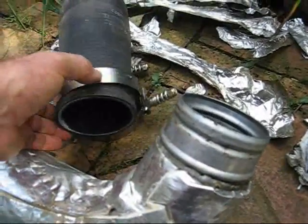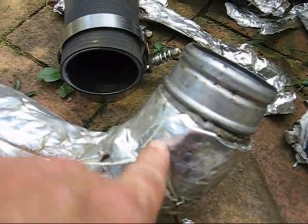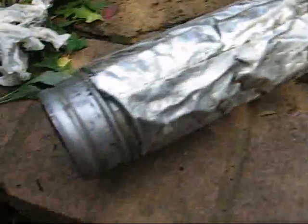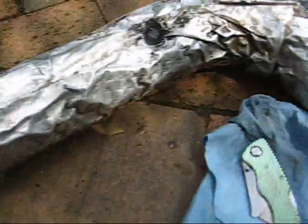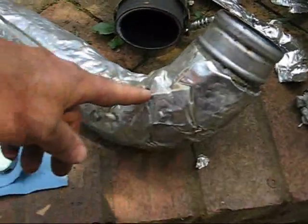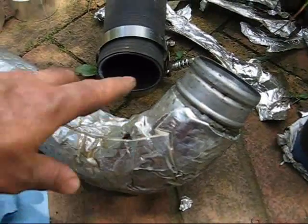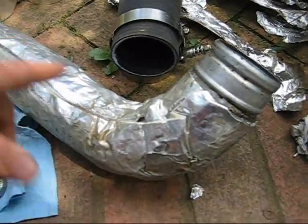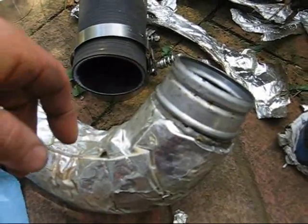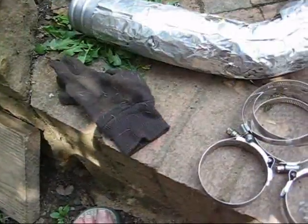These came with brand new ones. So I'll just cut this back, cut the insulation back enough so I can double clamp. It's the same on both ends, so on both sides, I'm going to double clamp that. Now I tore off some of the aluminum tape that held this together because it was looking pretty ratty. I'm going to clean that up and retape it. Cut this back, put the new boots on, double clamp it, give it another test drive. See you later.